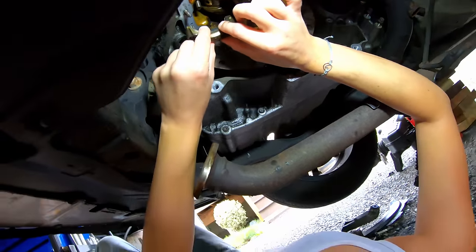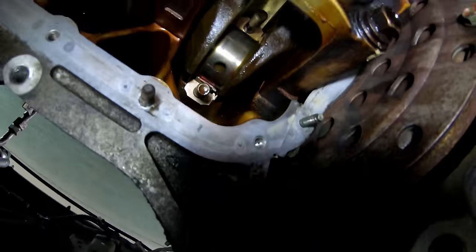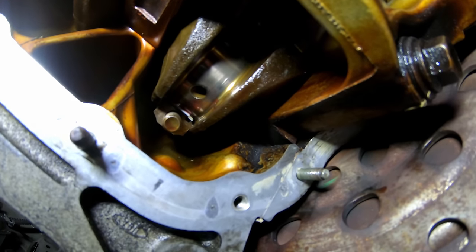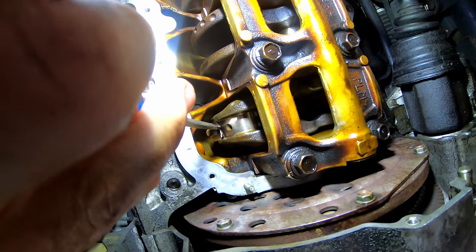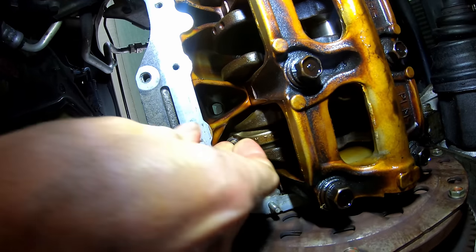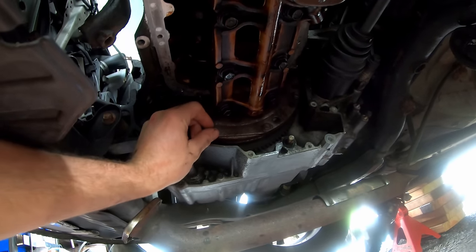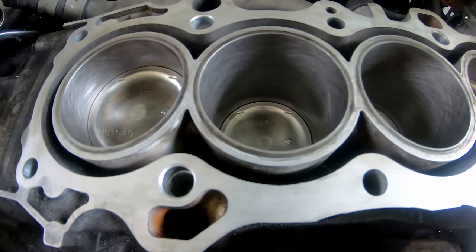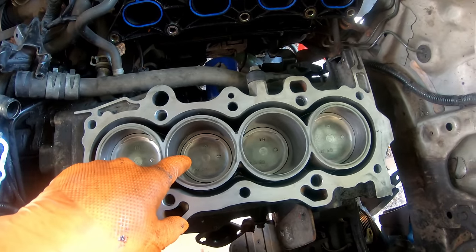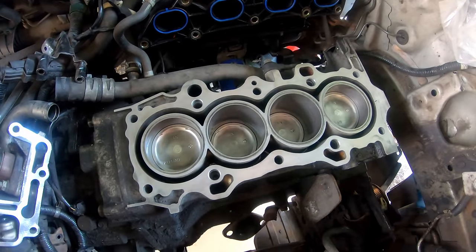We're going to do these rod bearings one at a time. Since I pushed the piston in, that rod bearing actually rotated a little bit. Got to get in there with a screwdriver and push that back up flush. That bearing is spun back to position. Now we're going to put the nuts on and torque them down. Got the pistons all cleaned up with the fresh ring set and a nice hone job — this thing should not be burning any oil anymore. Jen, one of these pistons you put in has the arrow going the wrong way. We're going to have to take it back out.